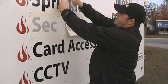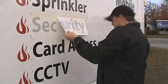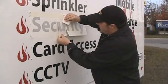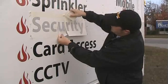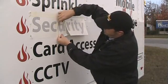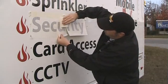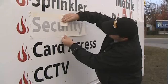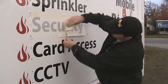So the next step I have here is I'm going to lay over this rivet. I peel the paper back, take it completely off. Follow my same rules, starting from the middle, applying even pressure. You know, you may have to work around another rivet as well to make the pressure work. So you do everything you can, isolating that rivet, pulling the vinyl tight down in this corner, and working your way to the rivet. And you can actually just go over the rivet with your squeegee.